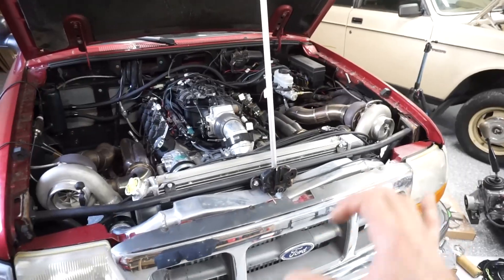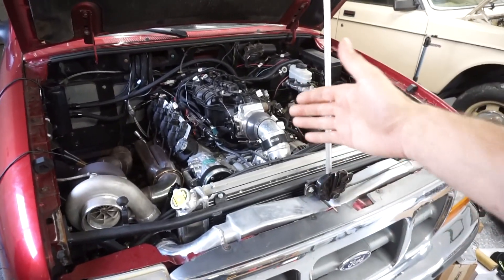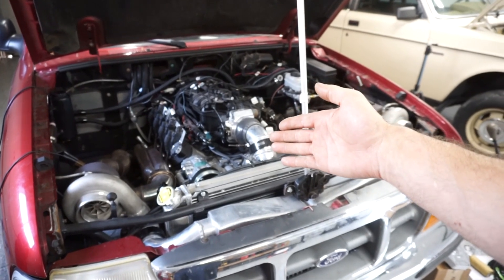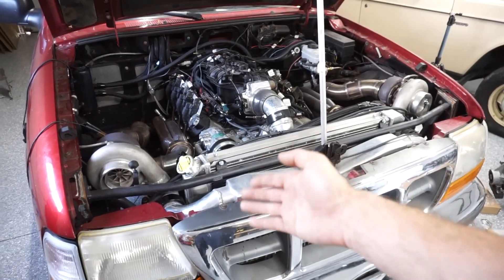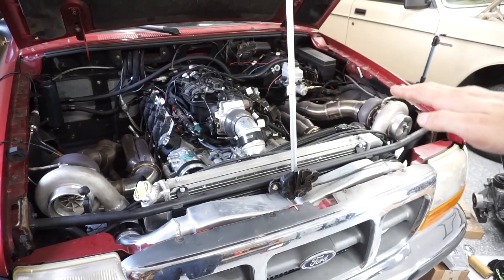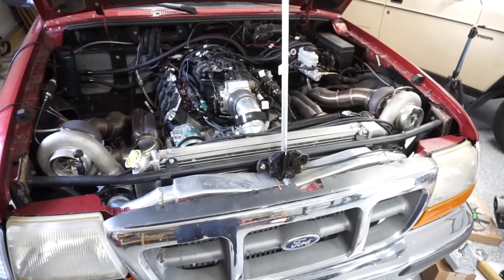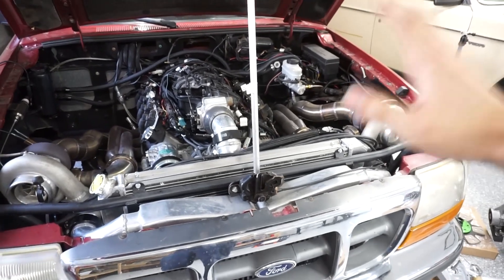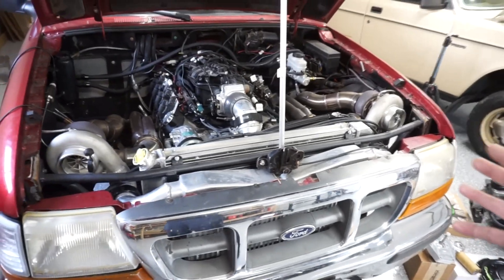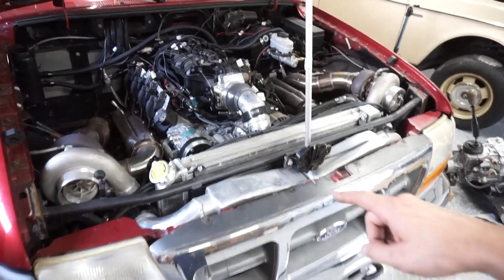The head gasket's not leaking - it is seeing high pressure, but it's because of where it's being measured from and it's not actually over-pressurizing the cooling system. One concern I have is at what point does it actually start to bleed pressure off into the tank, because if normal is 35 and it spikes with combustion gas to 50, at what point does it actually start to raise the pressure in the tank? That shouldn't really matter as long as you have a consistent baseline - if it's at 35 and then spikes to 50, you know that's a problem. So coolant pressure isn't as much of a blanket statement as it seems, and other people reading 20-25 psi may just be reading from a different spot.